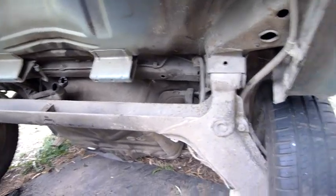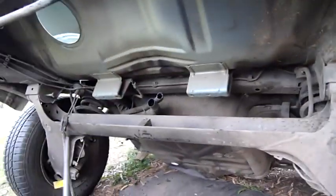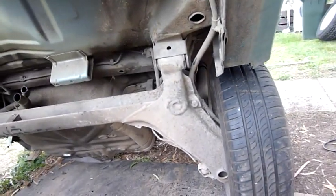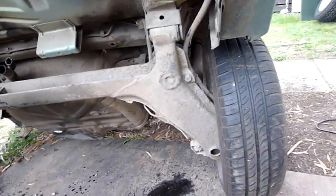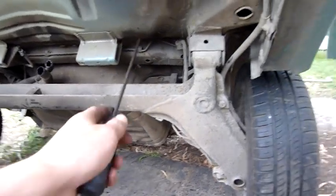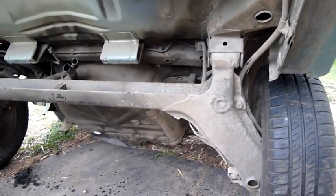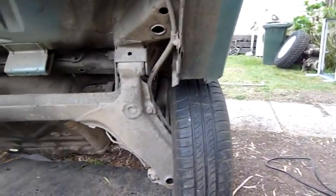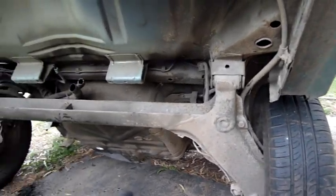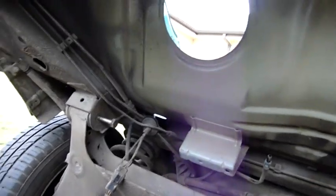Okay, well, underneath all I'm doing is disconnecting brake lines, handbrake cable, and that bolt's out, that one's almost out, and all essentially I've got to do is turn it upside down. I couldn't get the top end nuts off the shockers undone, but they're shot anyway, so I just cut them off with the grinder. Not much worth keeping under here apart from the axle beam, but I'm going to strip that clean on the top anyway and just weld a tray top to it, make it into a little workshop trolley, probably a meter by a meter square or something like that, with these tyres on it. Should be pretty good. Good for even bulky stuff like air conditioners and engines and things. The rest of this stuff can go in the scrap bin.